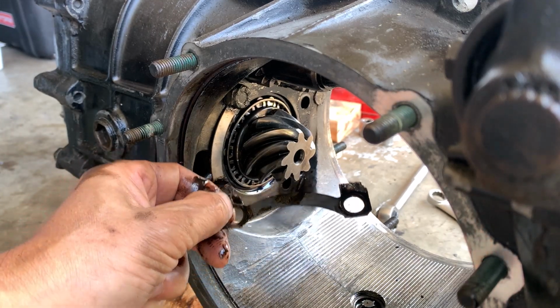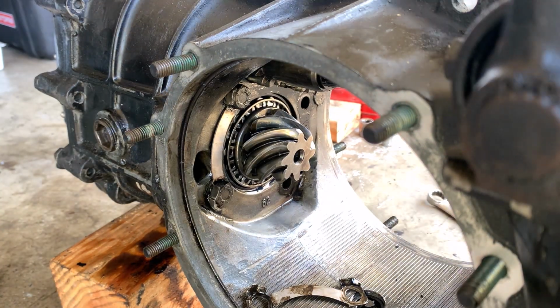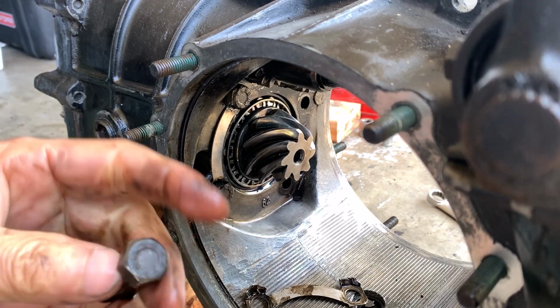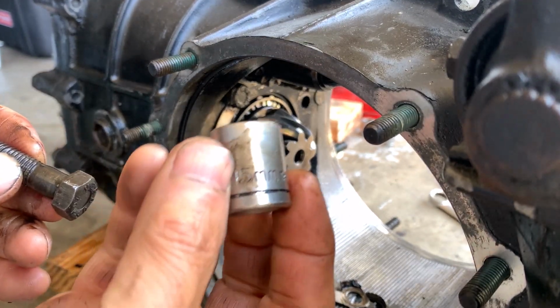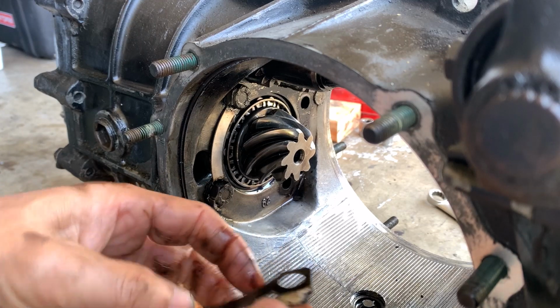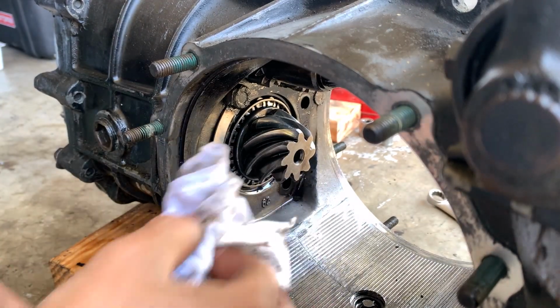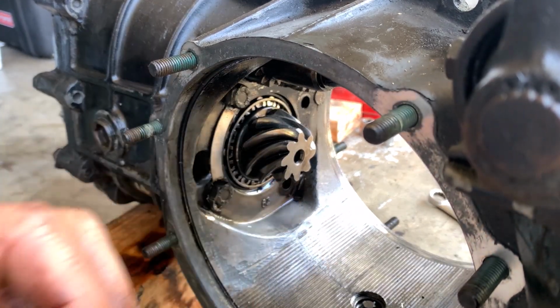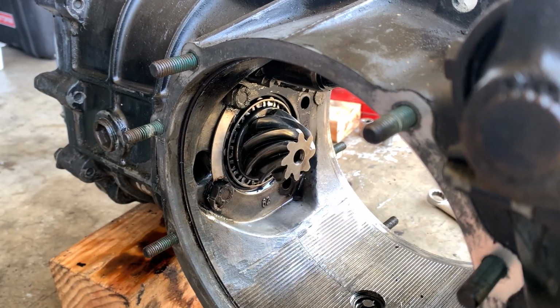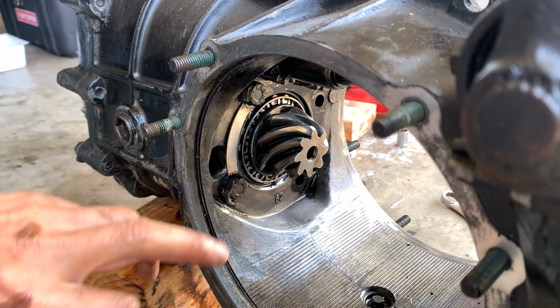Yeah, because of this, I thought, because this head, if you wanna take apart the same exact thing, this is 15. So the socket is 15, it fits well. But because of this lock, 15 didn't fit. I mean, originally I thought it's a 16, because it's all greasy. I didn't see what's going on inside, so I thought it's 16. I got the 16 hex, but I tried to torque it and it actually slips, and I was really worried. I didn't want to damage this head, and then I cleaned it well.